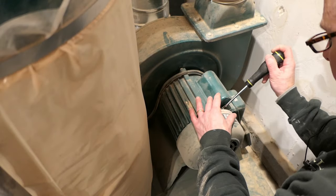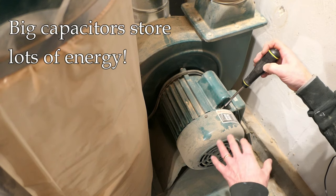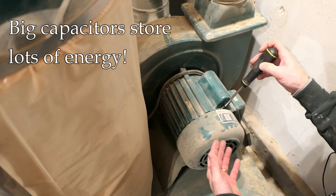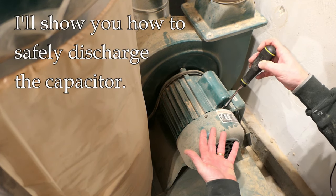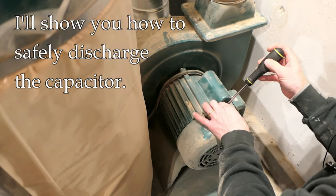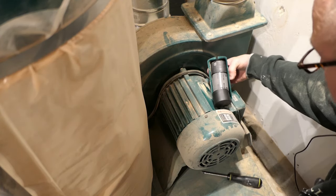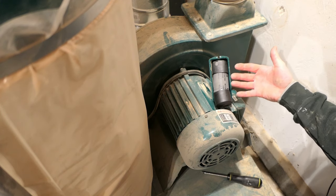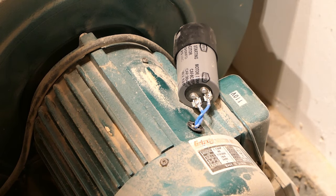We're going to find out, because there are ways of testing a capacitor. Let me take this cover off. Now, this is unplugged, and I've got to mention right up front: capacitors store energy — you can get shocked. This is AC power, so there is significant energy there and it could hurt you. So don't do anything stupid. I'm going to show you how to be safe with these things. There's my capacitor — notice how much bigger it is compared to those little ones I was showing you a minute ago. You can see there are two little connectors there.